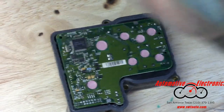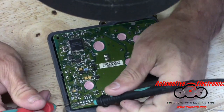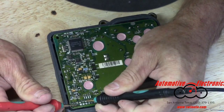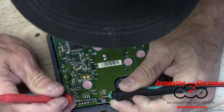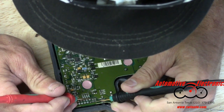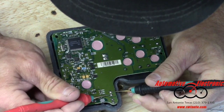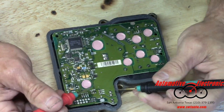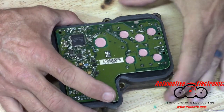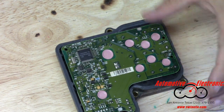If you want to go the extra mile, take your multimeter, set it on continuity, and you can check between pins to make sure you didn't get any bridging. Now we're going to have continuity between some pins because there's a trace running right there. These two are probably going to have continuity, and these two are probably going to have continuity. But you're not going to have continuity across these — these are so far apart there's no chance you're bridging anything, unless you've just gone absolutely bat-crap crazy with your solder.